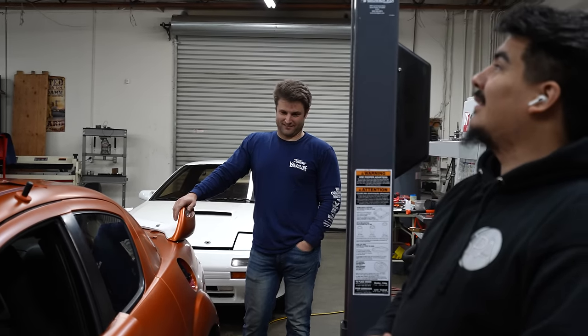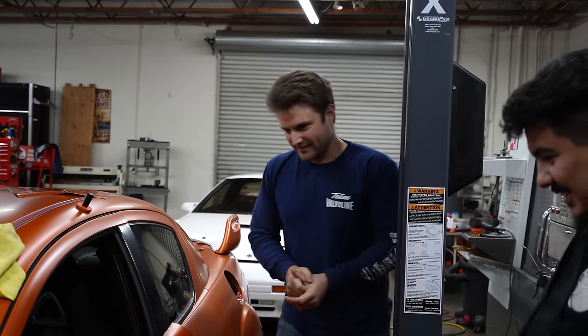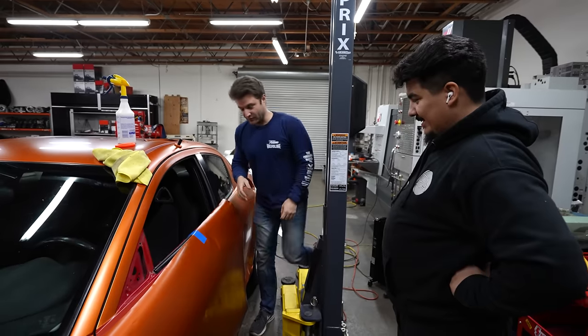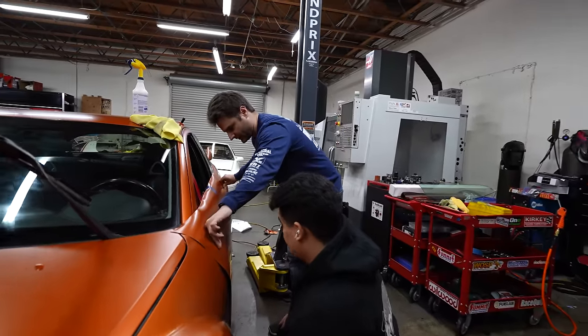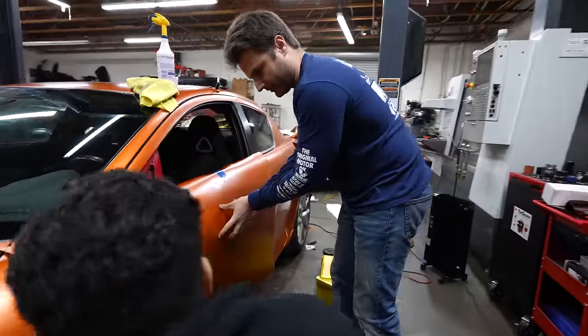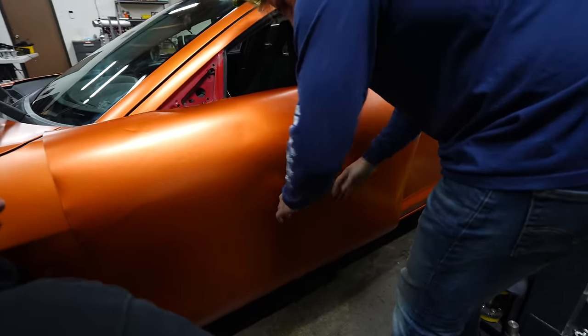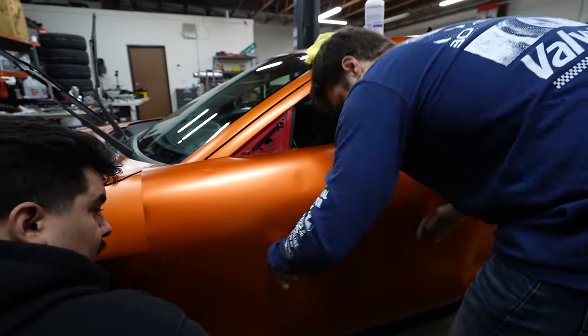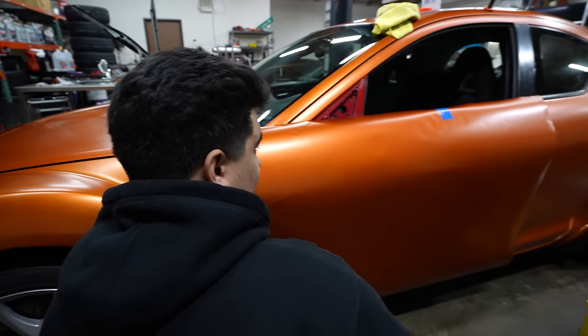What in the fuck are you saying? That made absolutely no sense. How did that make sense? I'm just joking. If you fuck this up I will laugh at you. Stick it straight across here since this is a nice consistent line. Heat it right here since this is the part that's sticking out a little bit. These will both pull down, this area will stretch open as it comes down. These will go tight and then you pull the rest of it down.